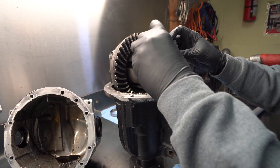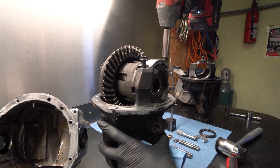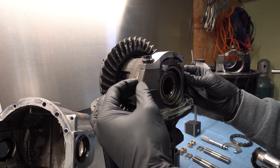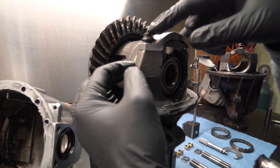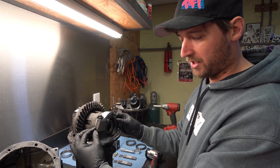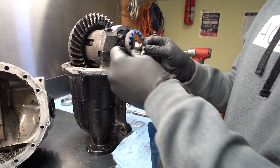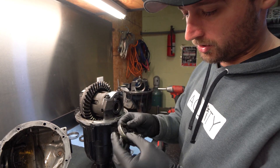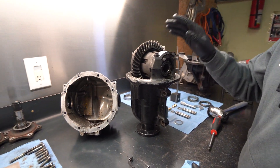Without that ring in there, you can see that this cap still fits no tighter than with the factory bolts. While these are stronger and do give you more clamping load, they still have the same sloppy tolerance to the caps. It still allows movement — this thing was able to move out, which is easily one thread of movement. Once it allows it to move a little bit, this thing is able to pop out or cock sideways. You get your backlash in the gear and it all just explodes. You can see where it even cracked this piece, ruining it.